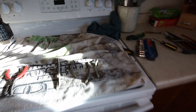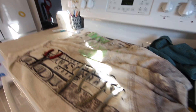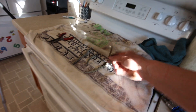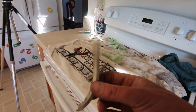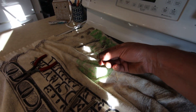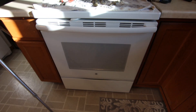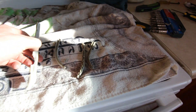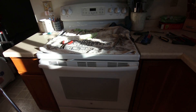Quick update on the headlight deal. If you're like me, I was a little bit nervous to do it. The biggest pieces I was able to peel off after making sure the polyurethane sealant was really, really warm are these three here. Otherwise it's coming apart with little chips and flakes. It seems to be a fine line between heating it up and being able to handle it. I've been putting it in maybe 5-10 minutes at a time as needed just to keep everything warm. It's actually coming apart pretty good. Once I get all the glue out, I'll be able to clean it up and start the reassembly process and do the other headlight.